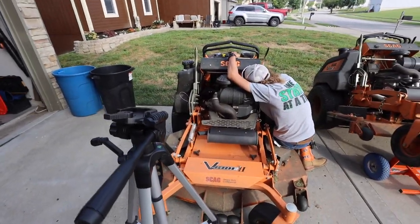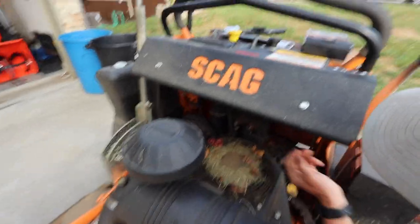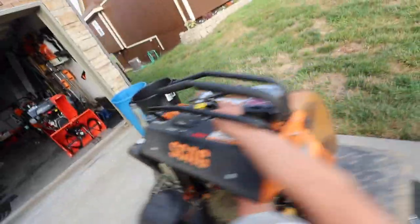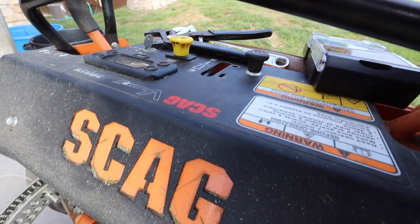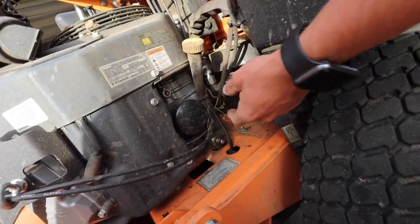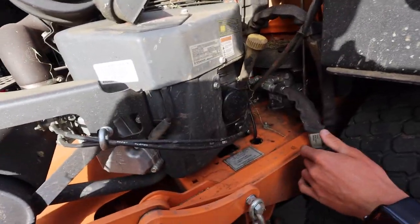It's a pretty easy little process — gonna take probably five or ten minutes to fix. First thing is getting it off there. It's a weirdly inconvenient spot; you gotta take off the nuts under this front part here, and we have a little tiny ratchet to do that. Pull that handle down through, and then there are little eyelets you're gonna have to unscrew. Just follow it down — I think it's zip-tied as well. We're just gonna have to unhook it from here and feed it through all these eyelets and zip ties.